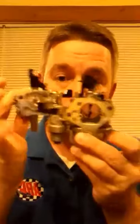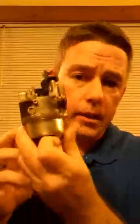And you get a lot better, like I showed you a while ago, a lot more flow through here. This is a 900 Venturi that I bored out and polished. This carb, if you can tell, still has dirt and stuff on it. This is one that somebody left methanol in for like a month and a half, and it messed it up. I've tried to clean it out, fix it, just still won't run right.